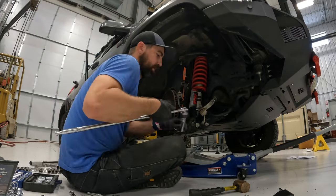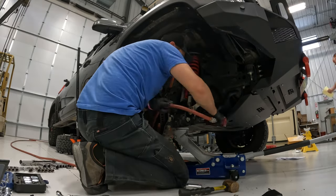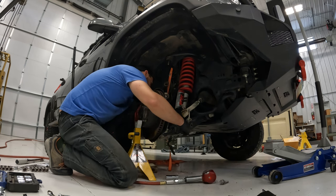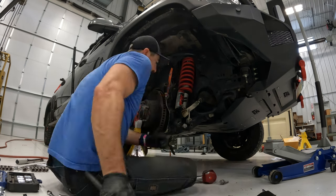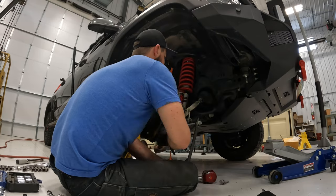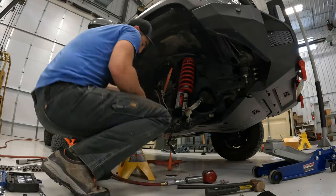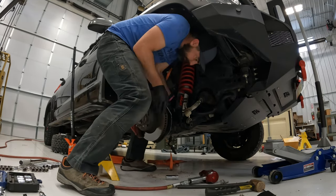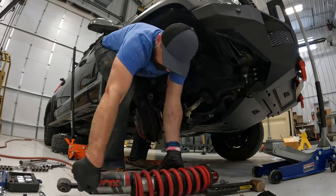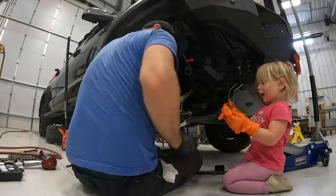Another trick: you can see the strap I have in there — it can help when putting the whole thing back together. See how using that smaller jack lifts up the lower control arm. Having a couple of extra tools around to maneuver these heavy parts when it's up on a jack stand while working solo is very helpful. You can see what I'm talking about — pushing down on the lower control arm by pushing down the disc to free up room for the bottom of the shock mount.